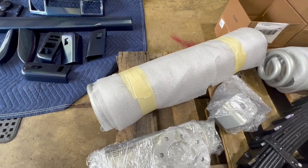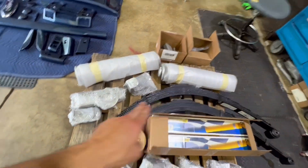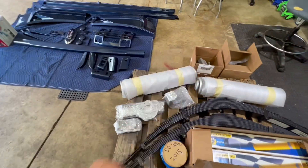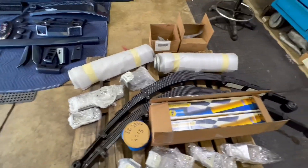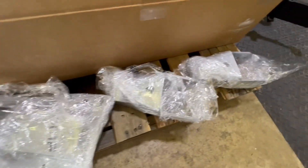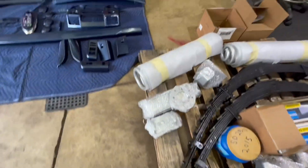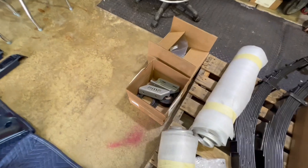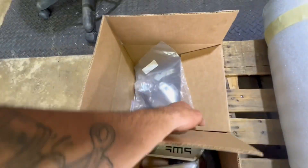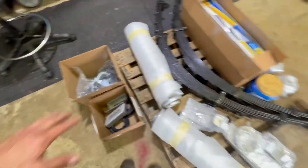PMF or Icon 7-inch coils, powder coat alien silver. PMF long travel leaf springs - these are for like a 7-inch lift with no block. I got new Bilstein 5160s. I have all the brackets for the long travel leafs, all powder coat alien silver. I have the U-bolts, inch and a half spacers for the front, some sway bar drop brackets, some isolators, and extended brake lines. We're going to do a video about that. This is for another video but you'll see it all eventually.